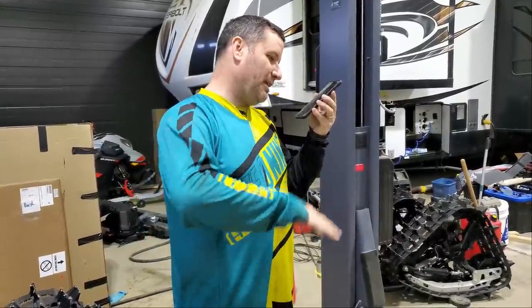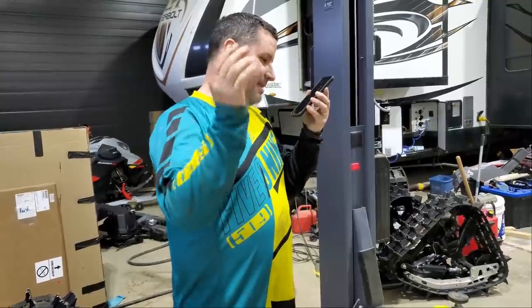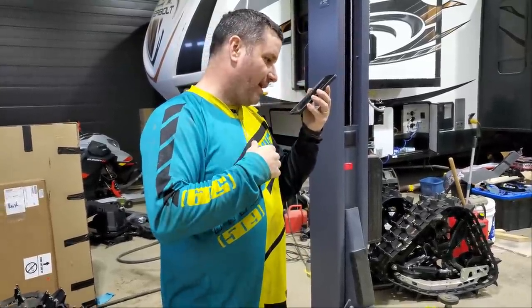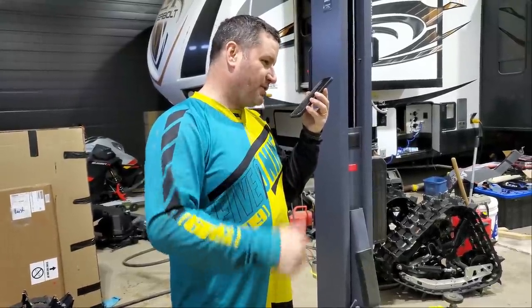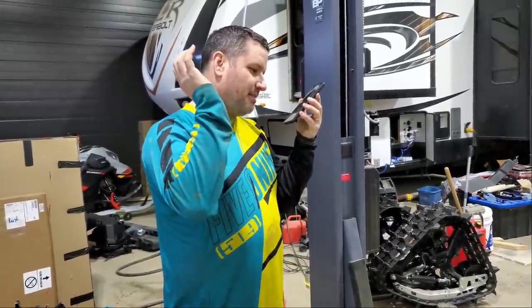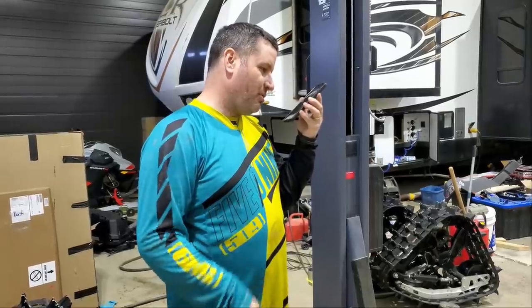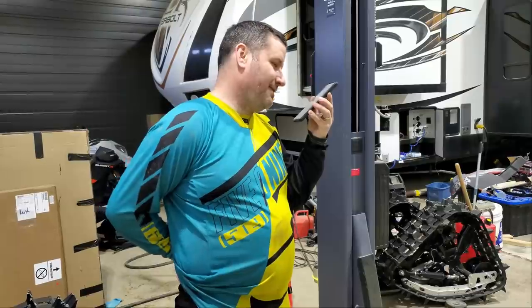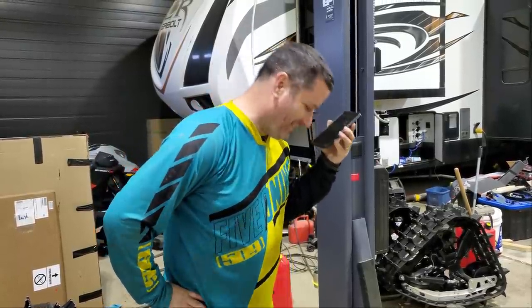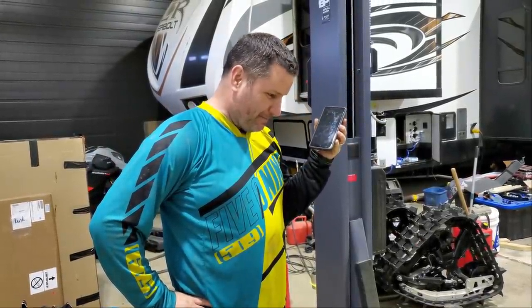So we dragged it out, lifted it up, and the water came out. There was almost nothing in the air box, but the top end was locked. So I pulled the plugs out and sprayed the water out. I'm just calling to see what I should do: spray WD-40, put the plugs in, pull the motor, or do oil changes and send it. How extremely dirty was it?